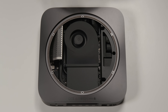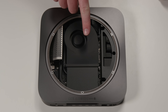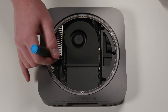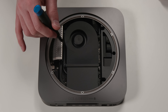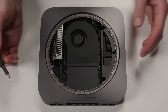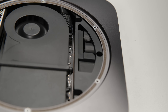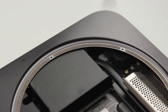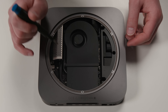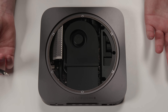We've got some good news and bad news. The good news is that this computer is actually really simple. Air gets sucked in through the bottom of the case into this blower-style cooler. This fan sucks air in and blows it through this radiator, which is presumably aluminum. You can see copper heat pipes going underneath the CPU, which is right beneath the RAM. The RAM is covered by an aluminum shield. We have the power supply on a board independent to the main motherboard — if that goes bad, you can swap it out. The bad news is the CPU doesn't look socketed, and the RAM, while it looks like it can be removed, is not immediately user-accessible — you basically have to tear apart the whole computer to get there.